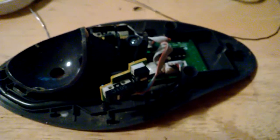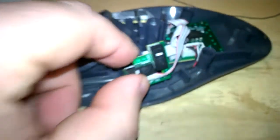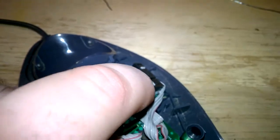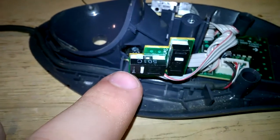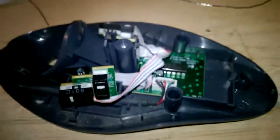Then you'll have a good working trackball. These are the Logitech Marble Trackman — they're like $30 new, and there's zero point spending $30 every year when you can just swap switches. So we took the switch from the back button and swapped it to the left click. If you wear this out again, you can take the forward button switch and swap it over for the left click, giving you another year or two until it completely wears out.